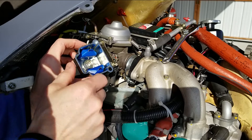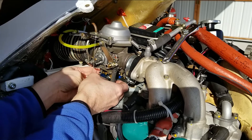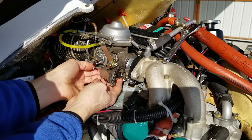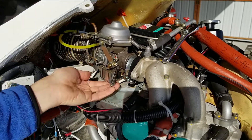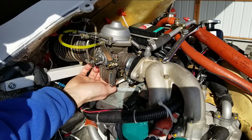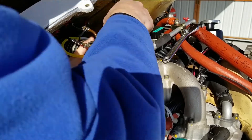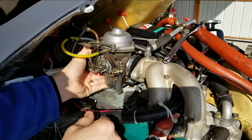Double-check that the floats are oriented correctly, everything's clean, no debris. Bring that back in very gingerly so the gasket doesn't fall out, give it a little wiggle-jiggle, twist it around, make sure it's fully seated and the gasket hasn't slipped. Then bring that bale down with your thumb and slam it forward. If you can't get it with your fingers, a pair of pliers to pinch it right on the center to seat it is all you need. Pop the carb back into the socket — twist, push, seat — but don't reef on your cables or levers, and it's fully seated.